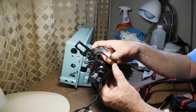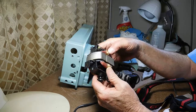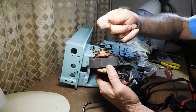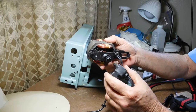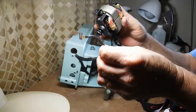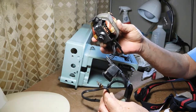There we go — this is what the internal motor looks like. I had the same setup on the 337, 347, 413, and 457. You can see the brushes and the commutator on the motor, which all clean up the carbon black. What's nice about having this all out is I can take a rag or Q-tip with crud cutter to wipe down all these parts, then polish the contacts and commutators, clean everything up, and test for continuity, shorts, and weak connections with my meter.